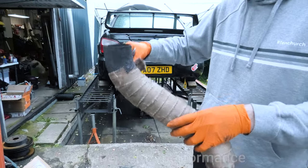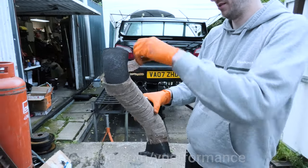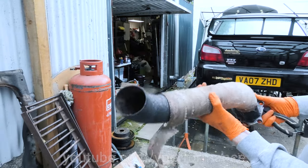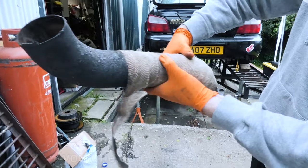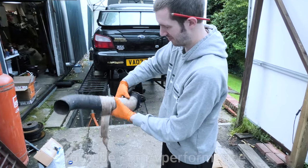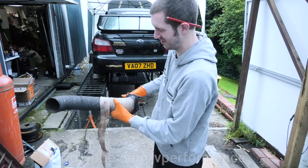So in terms of the wrapping material, what is it - some sort of fiberglass? It's just glass fiber, yeah. Glass fiber with copper weave or something, maybe rock wool. Also, wear gloves because it's glass and you get glass splinters. Ask me how I know. David, how do you know you get glass splinters? Because I got glass splinters from doing my exhaust when I wrapped it.